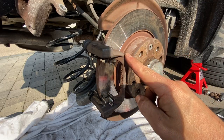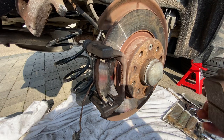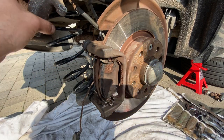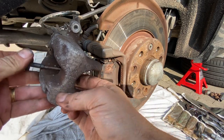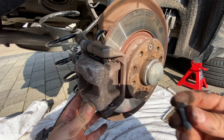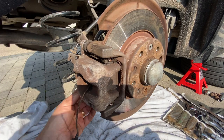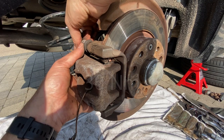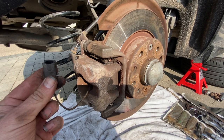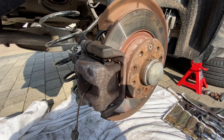With the disc back on and the caliper carrier in place, we can now get our pads back in and then bring the caliper down and refit it. We do this one and this one, then bring the caliper down, put the pad wear indicator back through the hole, slide it back over and get our two fixings in finger tight. Then we torque them up — I think up to 30 Newton metres on these — and once they're tight, pop the pad wear indicator back on the bracket and get that connected back up.